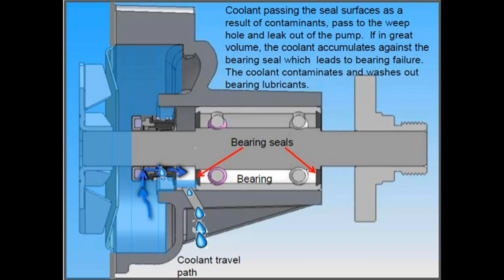As long as the seals are holding as they should on this water pump, there is no problem even without the weep hole. But all water pumps should have a weep hole, and that's the reason for the recall. If your truck doesn't have a weep hole on the water pump, you'll be getting a new water pump. We'll take a look at some actual water pumps here in a second and I'll show you where the weep hole is on the newer trucks.